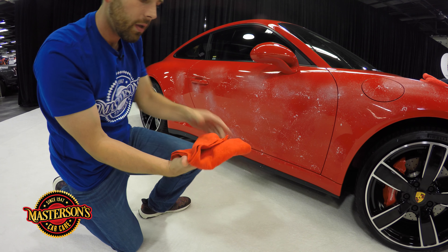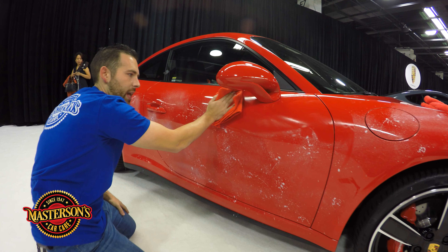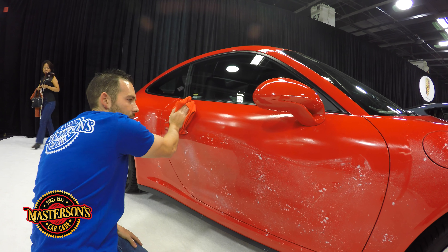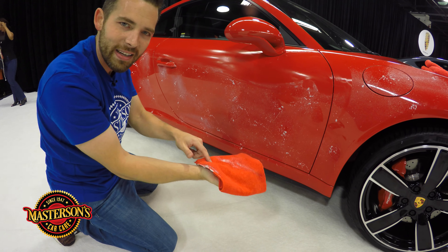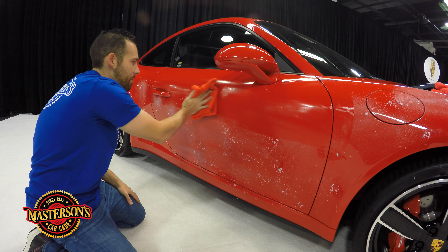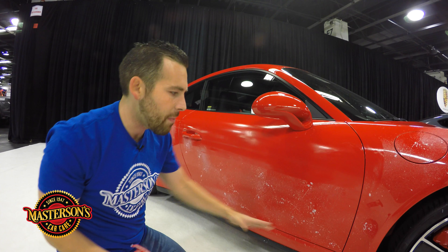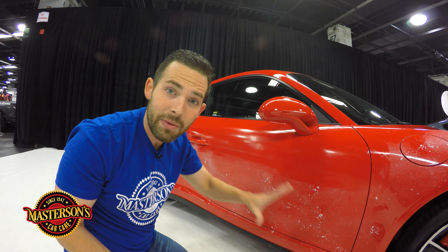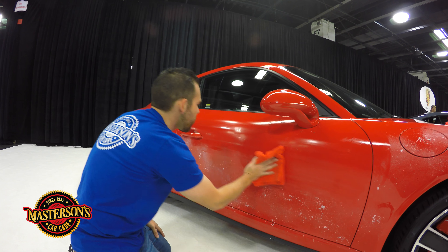That's because it's extra thick. It's not going to harm the surface. So now it's pulling off the ice cream stains that are on the vehicle. I'm going to first grab my microfiber towel — this is a 16x16 red microfiber. I'm going to fold it in fours. Always fold tag down, or remove the tag if you can. So now let's go over to the Porsche — let's start from the top and work our way down.